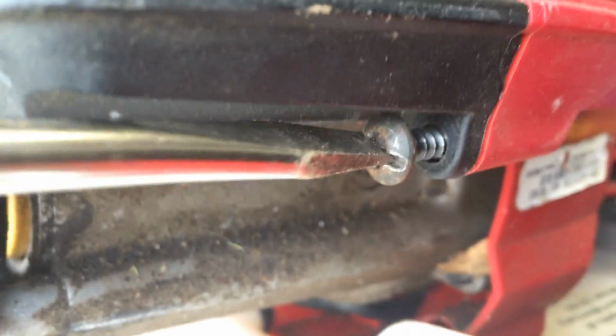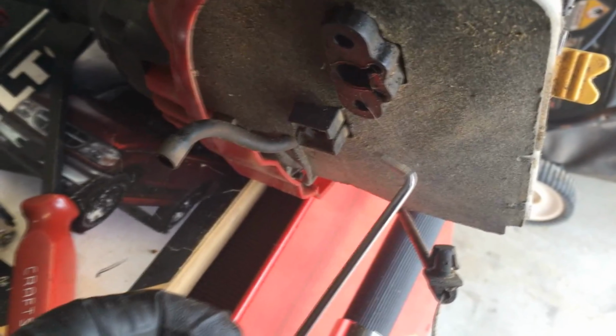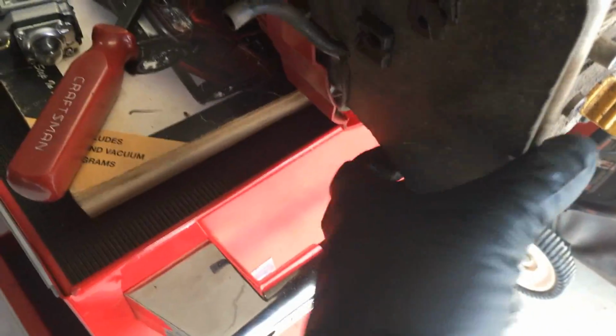So now there's just another part where the gas tank is actually kind of snapped in place. So you just go ahead and move it back a little bit. Go ahead and finish pulling this one out. As I drop the gas tank, and then you have these little plugs. We'll go ahead and stick that back in that one right there. So now this whole part should just come right off. We'll set this aside as well. So that just snaps into place, and that part right there, you just get 2 small-sized picks or screwdrivers and just kind of poke them through and pop it out. Not all that difficult. So now we can go ahead and remove our heat shield. This thing looks delicate, so I'm going to do my best not to screw it up.